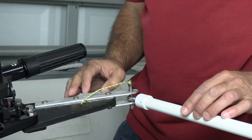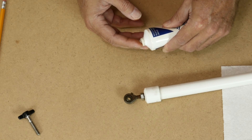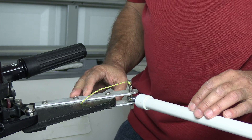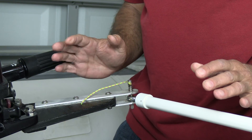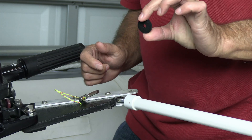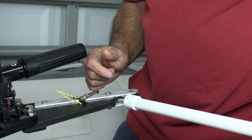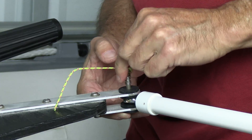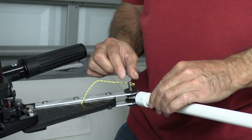I've been using this steering system for a few months and have been out on the water quite a few times. There are really three lessons learned. First, the clevis pin that connects the tie rod rattles. With the motor running, there was a lot of rattling at this connection — it was driving me crazy. To solve this problem, I used four rubber washers: one-inch OD, one-eighth-inch thick, with a quarter-inch hole in the middle. I put them above and below each of the aluminum strips, sandwiching the tie rod end. With the addition of these washers, there's no rattling.